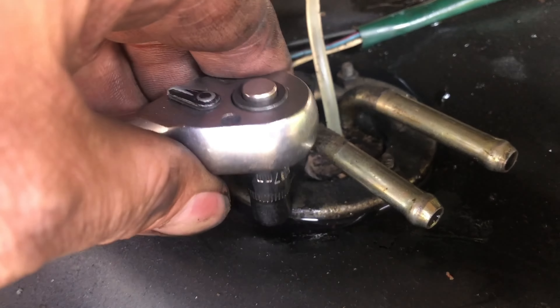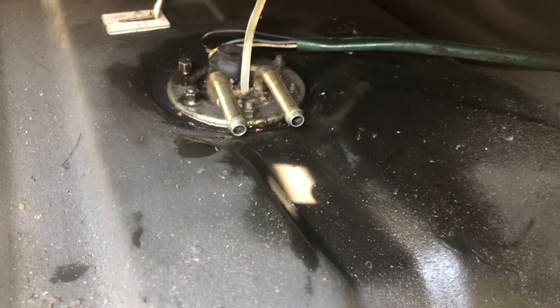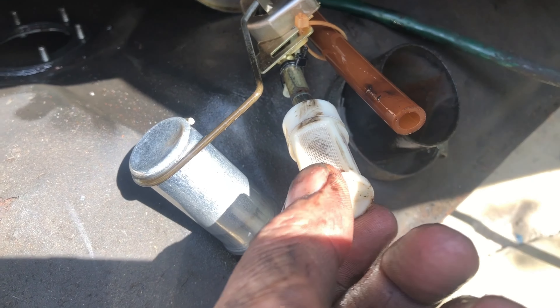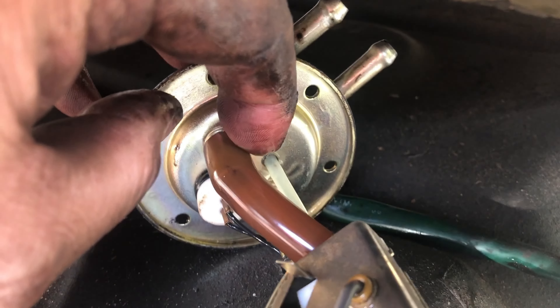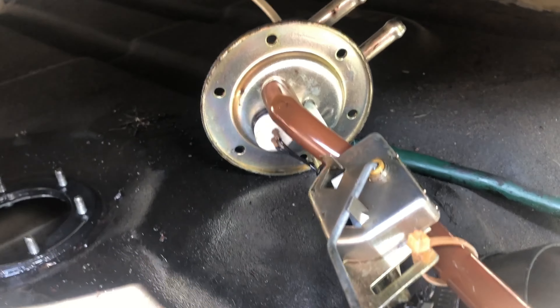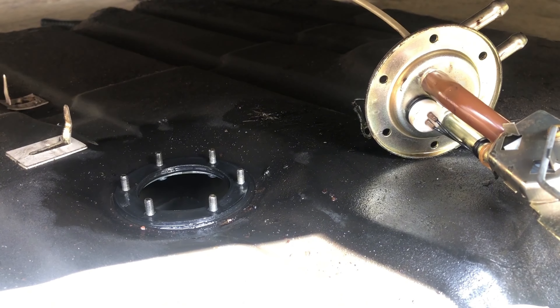These nuts are 8mm, so I'm just going to work here and remove them. Before I go too far I'm going to take note of how the sender unit sits in relation to the tank — there's a little flute at the front of the tank to remember when reinstalling. That's 6 nuts liberated and the sender unit gingerly wiggled out. I've worked out exactly why this leak occurred — whoever fitted the heater didn't bother with the correct fitting and just drilled straight into the sender unit. That explains the diesel dribble marks, and I'm now left with the problem.